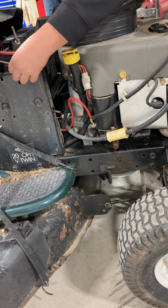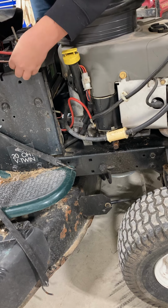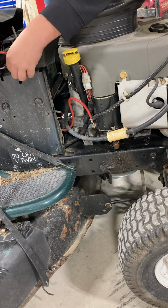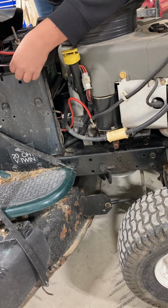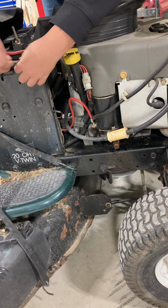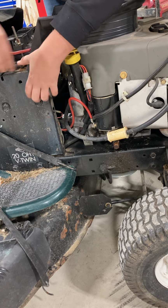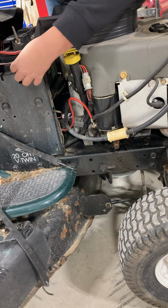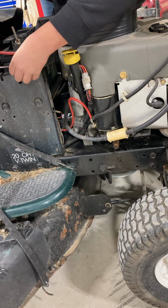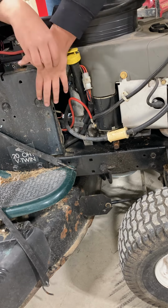I've been riding this thing around lately, and it does this weird thing. I heard that it misses, it pops real bad, as you can hear in that video. So maybe it's getting constant spark. When the piston's all the way down, it might be sparking still, and it's the right cylinder doing it, I should have mentioned that. Bad CDI, bad coil, who knows. Or it could be something wrong with the engine. Maybe somehow the carburetor's doing it. I doubt that. Just kind of gotta doubt that stuff.